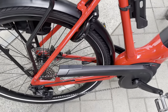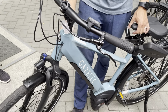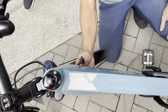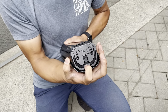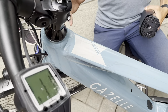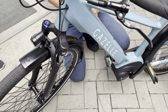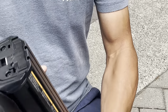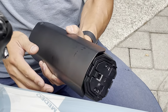The same key unlocks the battery. The keyhole is on the left-hand side of the display. Just turn it and it pops open. It won't come out on its own without you clicking one more time in the middle — that's another safety measure so the battery won't drop to the floor when you unlock it. You need to actively press it one more time, so it's a two-step operation. Do not attempt to pull the battery out without pressing that button first or you'll break it.